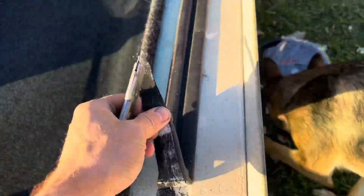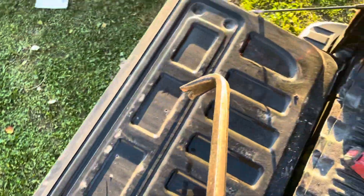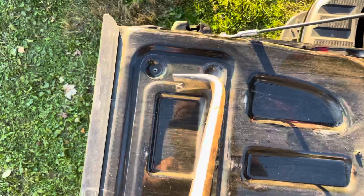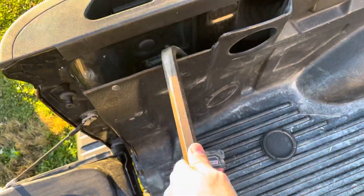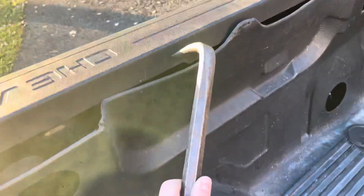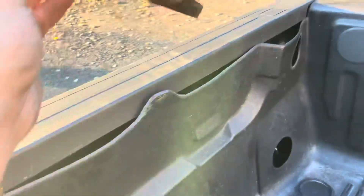Right now I'm using a utility razor blade scraper to scrape up the tar seal, taking it all the way around to bring it up nice and clean. I'm also taking out the plastic bed liner — they put a bunch of holes in this, so I'll need to make sure those holes aren't rusted, and if they are, I'll put a little paint in them after cleaning out the rust. I just pulled the liner out from underneath the rail using my pry bar — it was really only held in with two screws on this end.